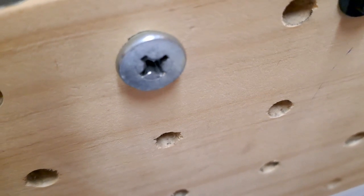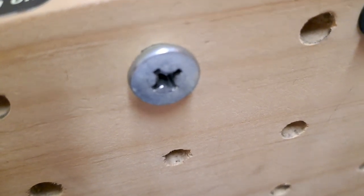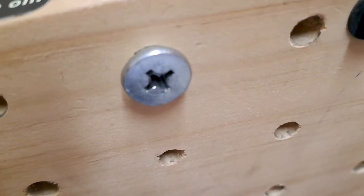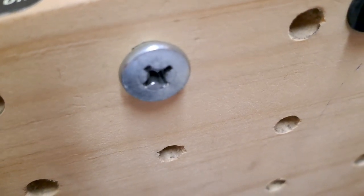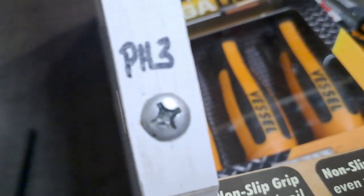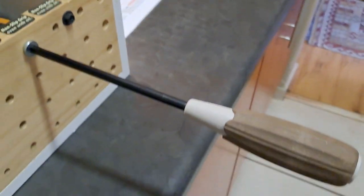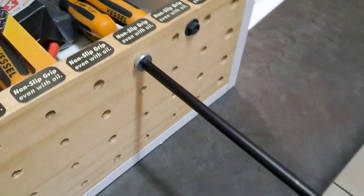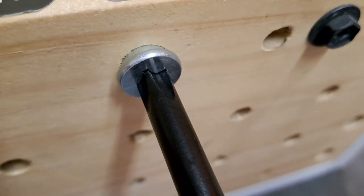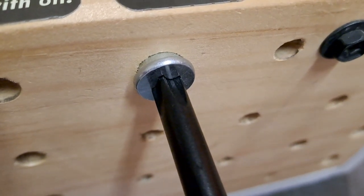Let's look at the screws. This is from a Toyota Hilux pickup in South Africa — a GD6, the latest 2023 model. At the tailgate there's a hinge-type arm that holds the tailgate up; it's got two of these screw bolts on each side and it's JIS. I must mention: the JIS screw is 4.2 millimeters deep versus the Phillips at 7.1 millimeters deep — there's a huge difference in depth. If you use a JIS screwdriver and insert it nicely and firmly, it will actually stay there — it'll hang in the air. If it's Phillips it'll simply fall out even if you super-magnetize it. This bolt being outside is normally rusted, so if you need to work on the pickup you have to use a JIS screwdriver.